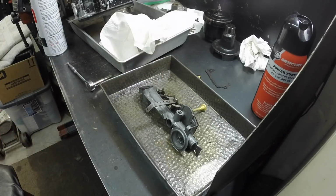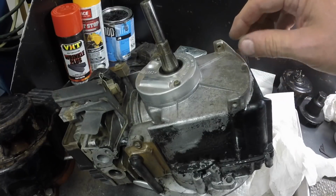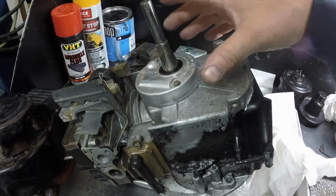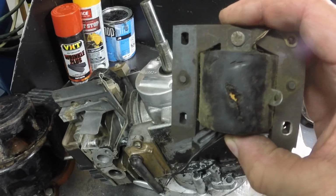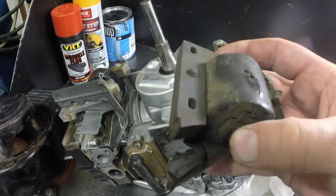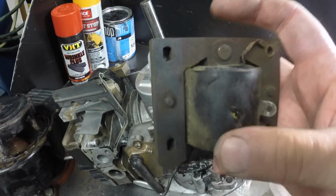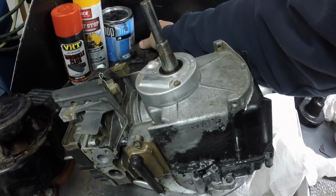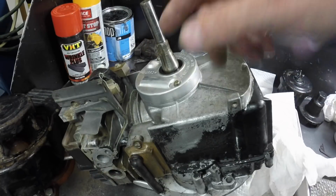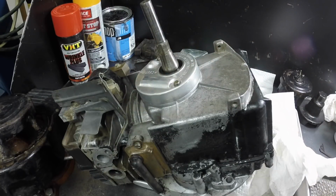But anyway, there we go. The carburetor's all clean now. I also decided to just stick with the magneto. I did gap the points to 20 thousandths and put the cover on. I'll check the coil when I get a chance and charge up my thing. I'll keep the coil and the flywheel original parts of this engine, because it runs perfect with what's on it.